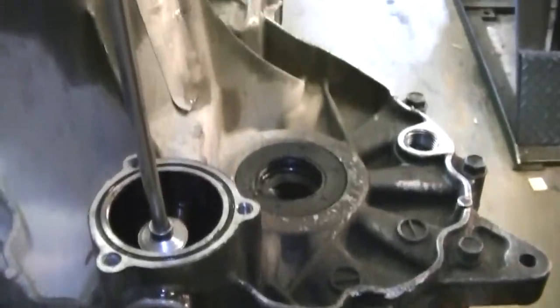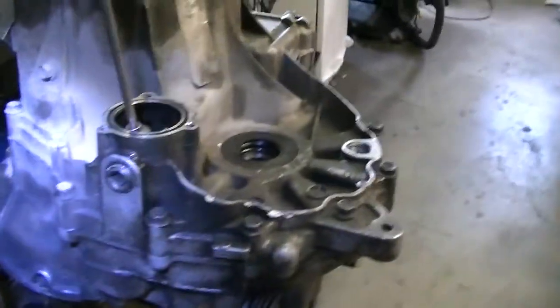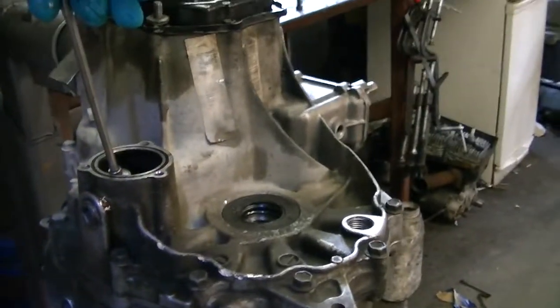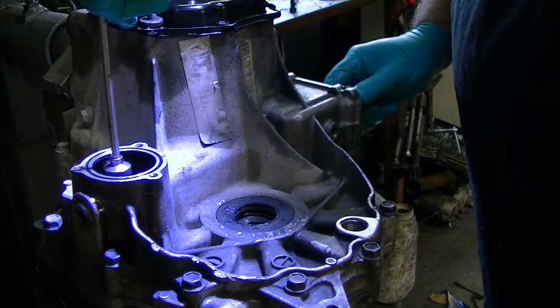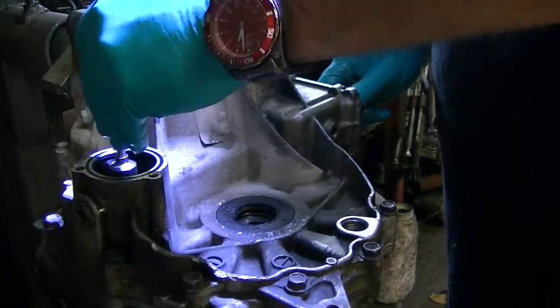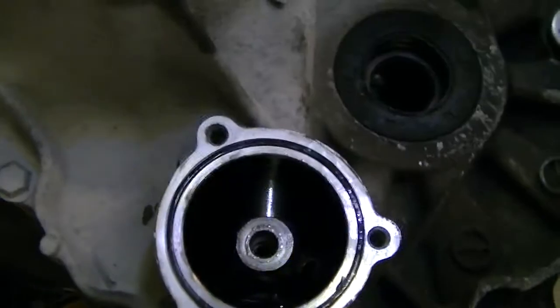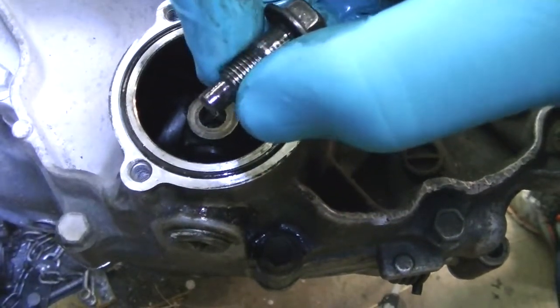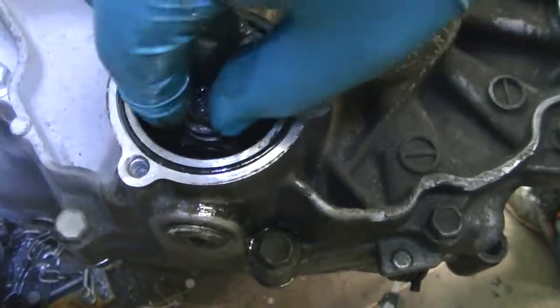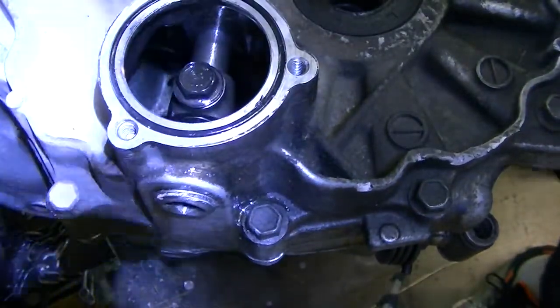Then I'm going to raise this up so you can see the other side. This angle right here is what I'm looking for. I'm just going to wiggle this selector — which would be going down if it was in the car — and I'm just sliding it right back in there. Once it's slid in, I pull my magnet off and you'll see the threaded holes. This bolt right here has a little machined end on it so you can push it in to line the threads up; just give it a little wiggle like that, start it, and run it down tight.